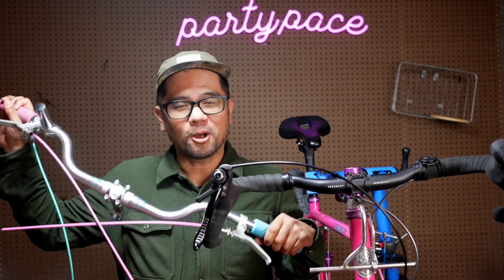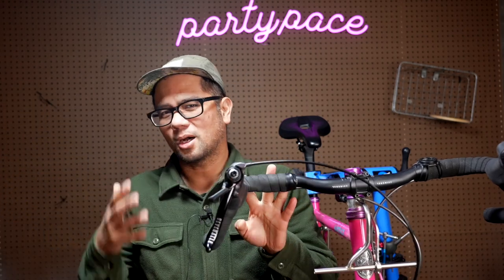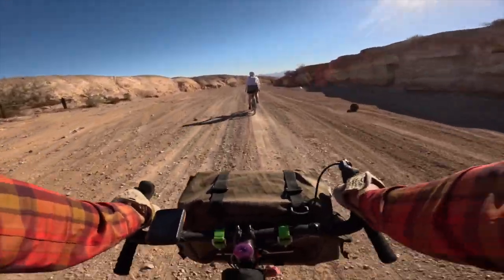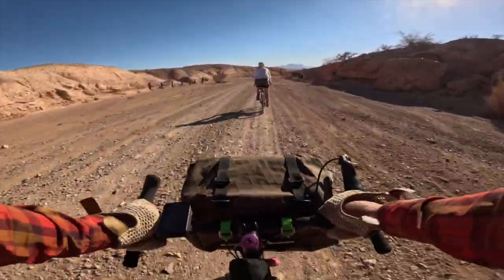What are the cons of curly bars? The biggest cons for me are when I'm riding on really steep and technical descents. Although 47 centimeters is fairly wide for a drop bar, a lot of the new alt bars coming on the market are 800 millimeters wide, and that width gives you a lot of control on sketchy descents. Another downside is that by the very nature of a drop bar you're pitched forward a little more, leaning over the front of the bike, and this makes it feel a little easier to go over the handlebars. Drop bars also suffer in sandy conditions — because of their width and the added weight on the front of the bike, I find I tend to sink into gravel and sand and don't have quite the leverage to correct the steering.